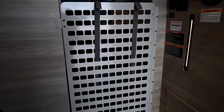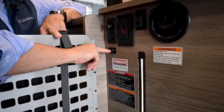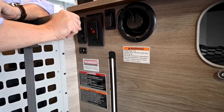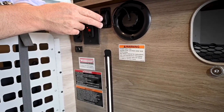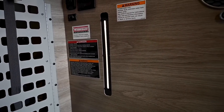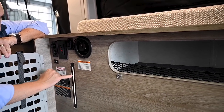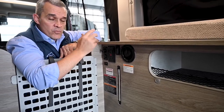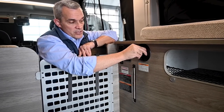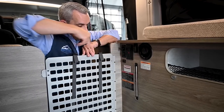Right here, bending down underneath the bed — and this bed is a little bit higher with Winnebago's design — you have USB, 12-volt, a temperature sensor for the Truma VarioHeat so it reads the cabin temperature when you're setting it, and a GFI outlet. This little light switch activates the sight glass, which gives you the true water level for your fresh water tank housed behind this cabinet — not just a one-third or two-thirds reading, but the actual level. You can also fill your water tank with gravity fill right here in addition to hooking up in the back.